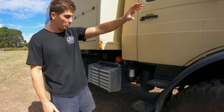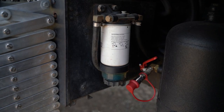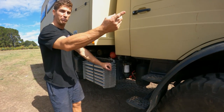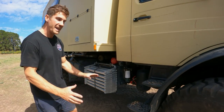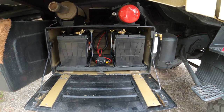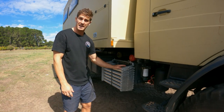I've added a water separator and pre-filter to our main fuel tank. There are also twin filters and another glass bowl filter in the truck - we're well filtered with our diesel. We don't want dirty diesel ruining our injectors. In here are twin batteries. We also have a fire extinguisher and the 10-ton bottle jack that came from the army.